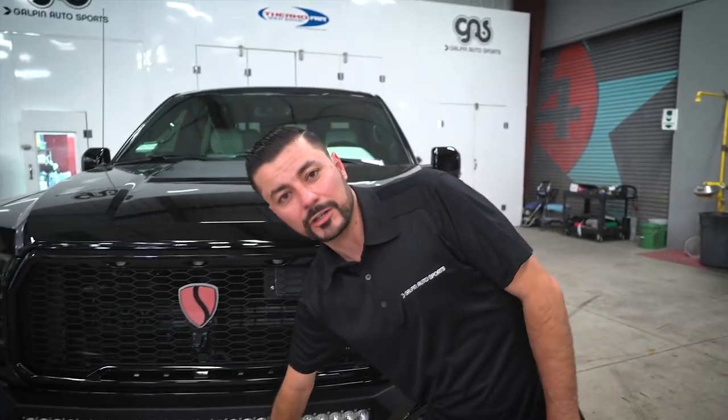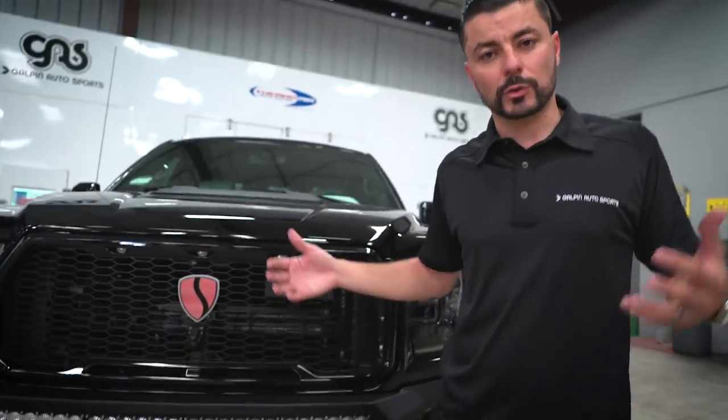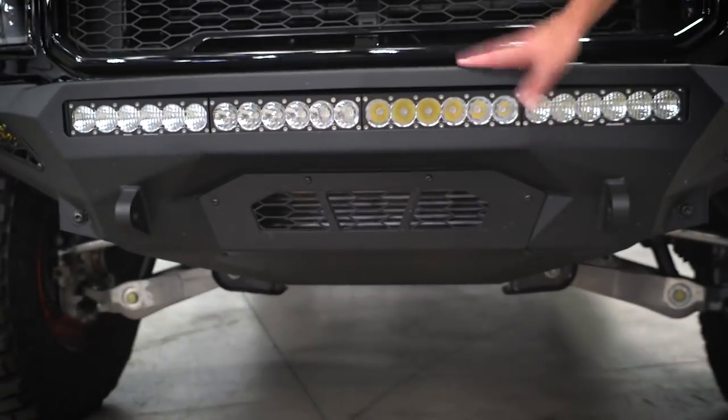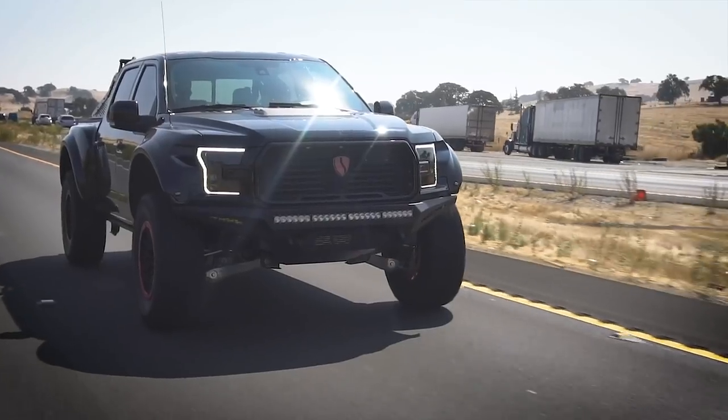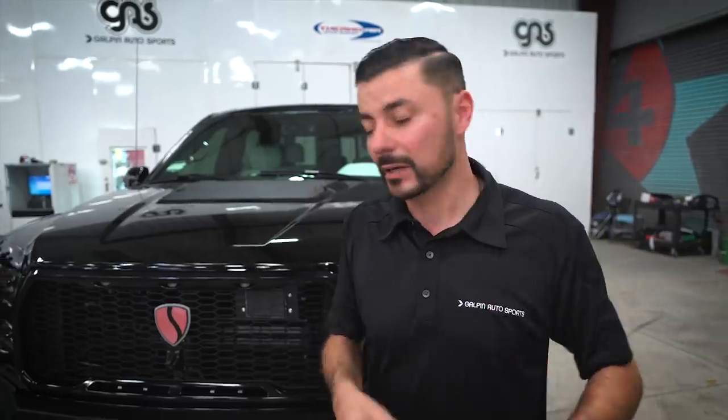So if you take a look down underneath this bottom grill, we've installed the intercooler. With these vehicles that are turbocharged or supercharged, primarily in this turbocharger's case, you want to be able to cool the charge temperatures that are coming into the vehicle. So the intercooler will allow the outside ambient air that's getting sucked in to be cooled and then given into the engine. Colder air results in more dense air, which is more oxygen packed air. It's going to give you more power.